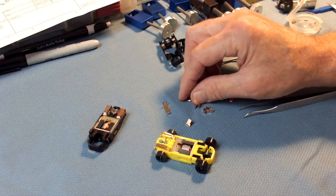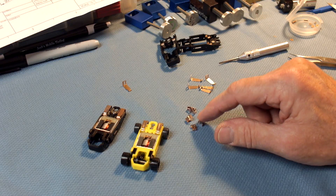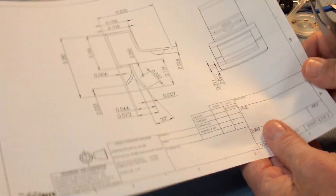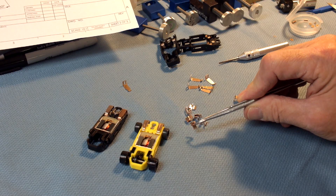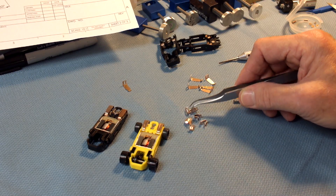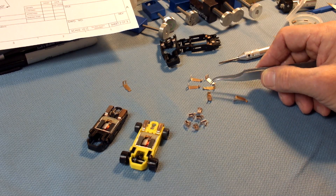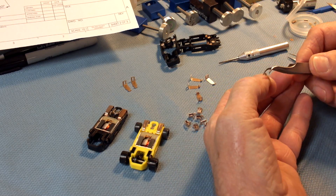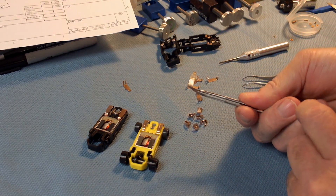So that's the rundown on the new parts: the new heat-treated pro hanger — I'm exceedingly pleased with how those came out — with the special forward bend at the factory, so in my opinion you don't have to do any tweaking at all on these hangers unless you step on them, then just get a new one. Put them in the car and they should be really, really good with no post-installation tweaking required. And our new long-travel ski shoe has the extra travel built in so you can get away from running the infamous step shoes. Thanks for watching.